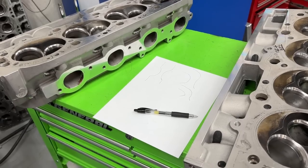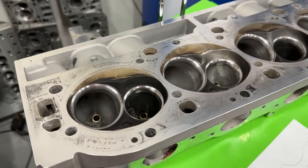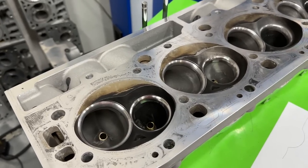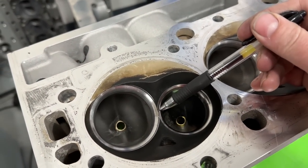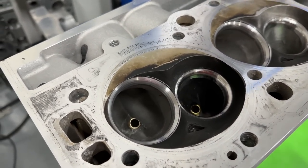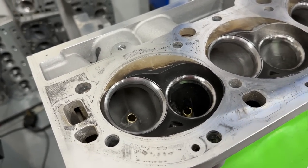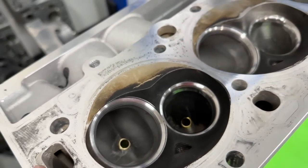At first I was hesitant, but I ended up doing it — I'm going to show you what's been done and why. Here is this one: I redid the valve job. You might say why did I redo the valve job? Well, one, I wanted to make sure I put in a good valve job, because the 317s just got a good valve job — why not put one on this too? The heads are apart, let's make sure it seals up, and usually it picks up a little bit of flow. This one has the 225 intake valve and a 188 exhaust valve. Unlike the 317s, I kept the 45-degree valve job on both of these. The 317 is definitely more of a racier head, so I was thinking more street use for this one. Let's just keep them at 45 degrees. It's not even one of my aggressive 45-degree valve jobs — it's the middle one; I use this for lots of stuff.